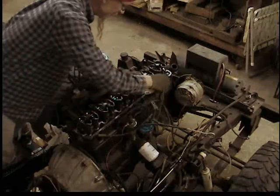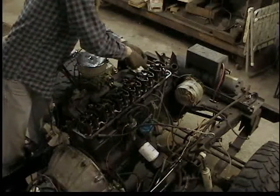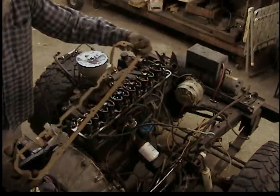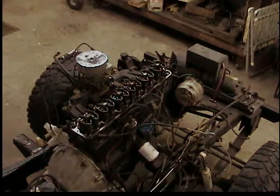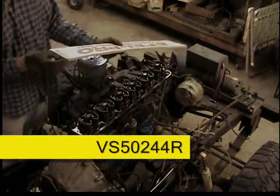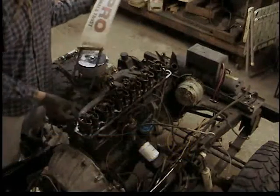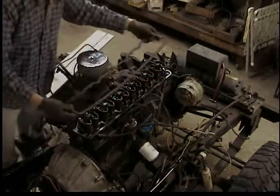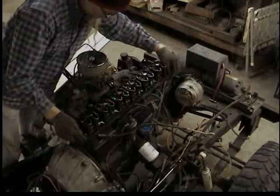Clean everything up — if you've got any debris from tapping, get it off, get it nice and dry so the new gasket sticks. The valve cover comes with a perfectly good cork gasket, but I'm not going to use it. They say to add a light layer of silicone to it, but I went ahead and bought the Fel-Pro gasket. Don't buy it at AutoZone — they want 48 bucks for it — but I found it on a website with all the Jeep parts I'd ever need for only 18 dollars. These Fel-Pro gaskets are nice because they come with the sealant already on them, so no silicone needed.